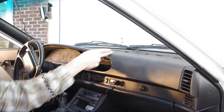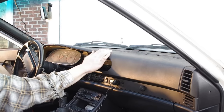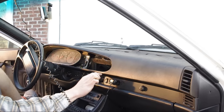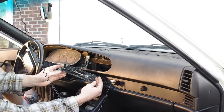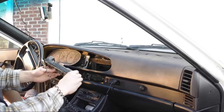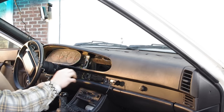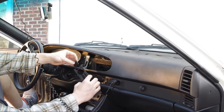Here's the problem: there are cracks up and down and all across the top where the air comes out through the dash to defrost the window. You have to get everything out of the way. I took off the vent and the plastic piece that opens and closes the airflow, and the trim pieces also have to come out, along with the climate control module. On an old car this stuff gets really brittle from heat cycling every day — warming up and then cooling down — and the plastic doesn't like that.